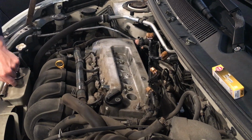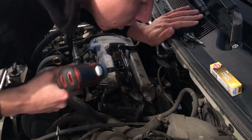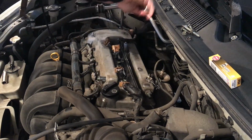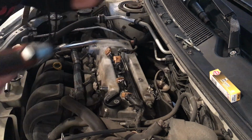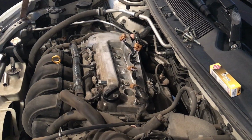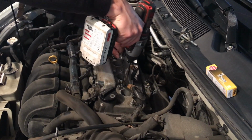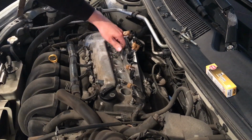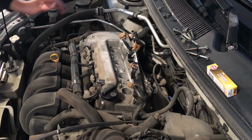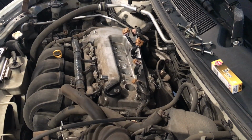This one's a 12mm. So 12mm out. All right, and then you got 2 right in the center here. And I just saw the valve cover raise up a little bit, so that's a good sign. All right, so now with all these off, we can go ahead and see if it will come up. It does not, so we'll grab our pry bar and we'll get that out.